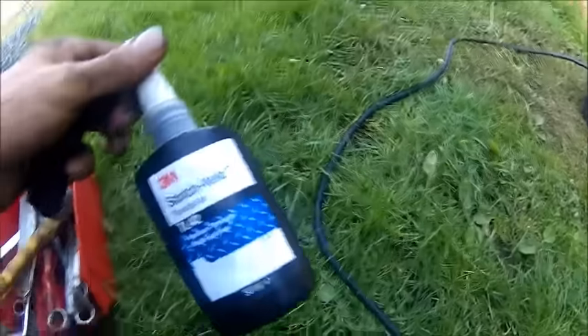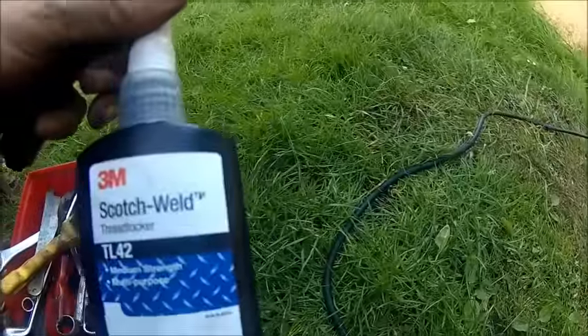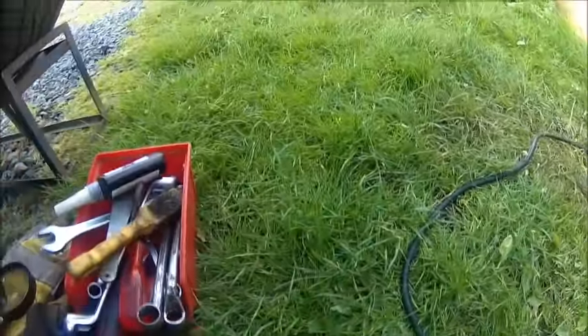Everything is back together — no nuts and bolts left over, so we probably fitted everything. I just noticed my rear engine seal probably needs replacing, but you can actually do that with the engine in place. It's a fairly clever design — the ring is split in half so you can take it out, but I don't care at the moment. I actually used the Scotch Weld threadlocker because that's medium strength. The loctite I have is super strength and I don't really want that, because at some point you might want to get those bolts out.